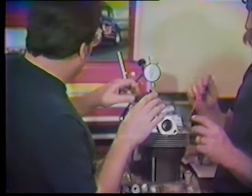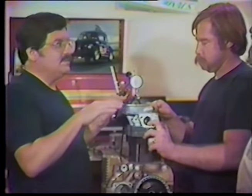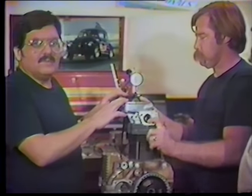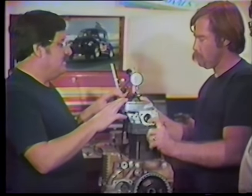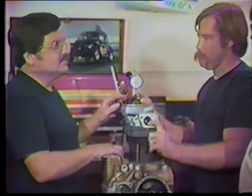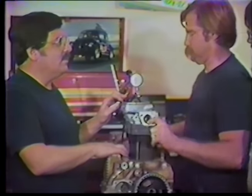I'm not going to correct this now because I want to show the Erson rocker. To get correct geometry when a change needs to be made, don't make big drastic changes — analyze the problem. If you can't see the solution, call somebody. It is obtainable and simple to do. The smaller the cam lift, the less critical geometry is. A cam with 380 thousandths lift is far less critical than one with 500 or 600 thousandths.